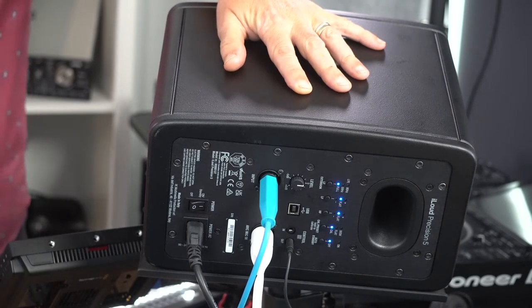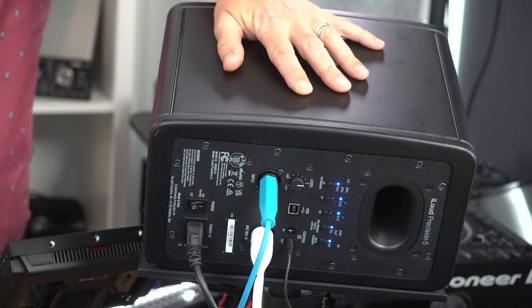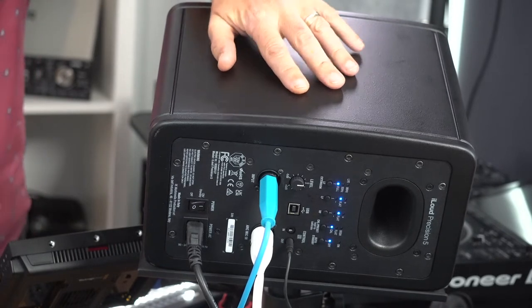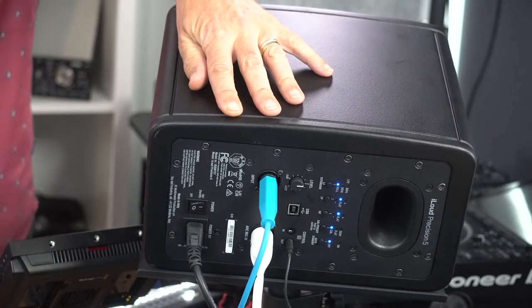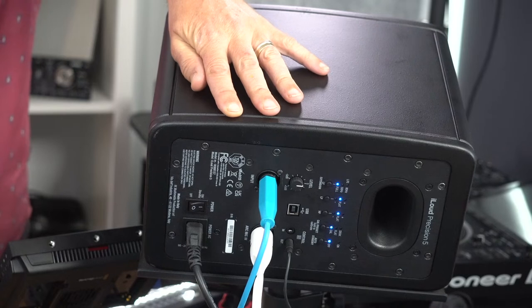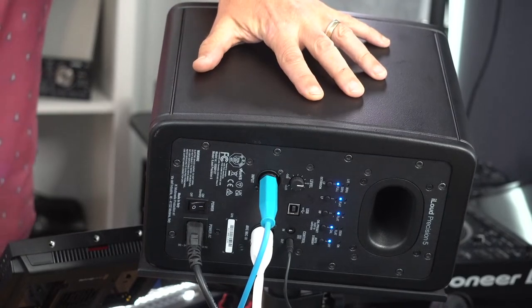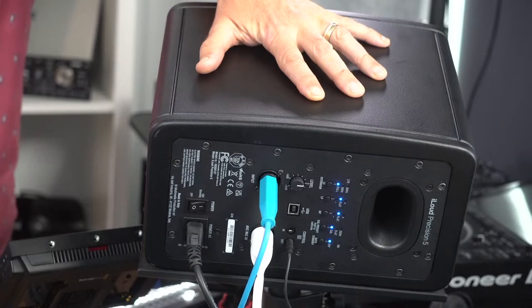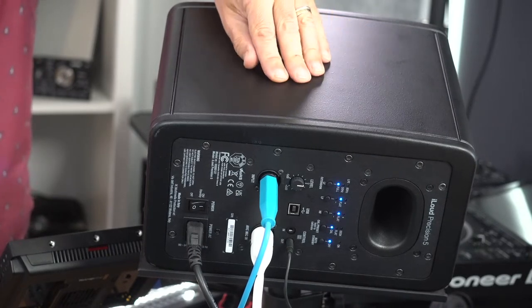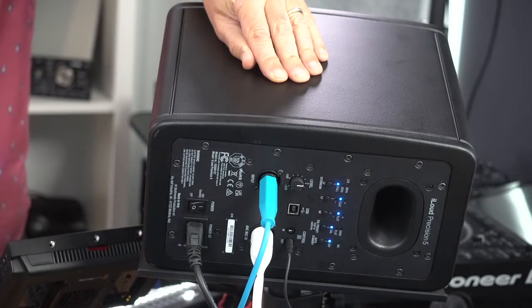And they're a step up in a couple of ways. One, they are extremely well engineered as far as the flat frequency response goes. From about 35, 40 hertz right up to way above human hearing, the frequency response of these is extremely flat. And so they are delivering the kind of trustable frequencies that you get from speakers that cost a lot more than this. So while these are not cheap, this is going to be one of the things that we end up talking about a lot in this live review. While they're not cheap, they punch above their weight in a few ways. They've got a really nice crossover that again keeps that graph of the frequency response very, very flat. So that's the first thing.